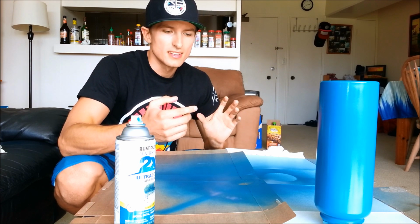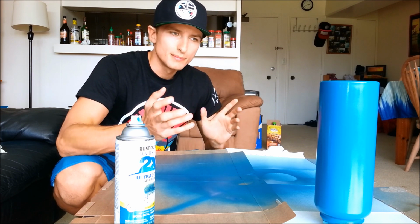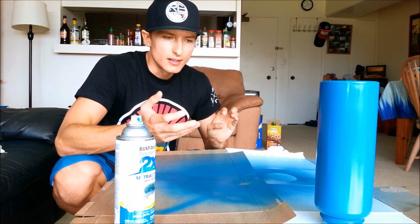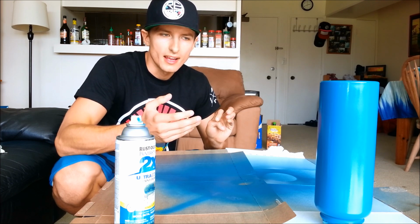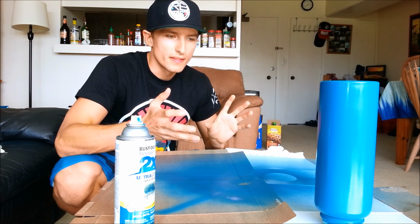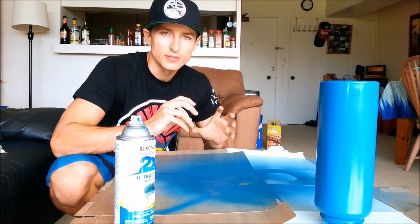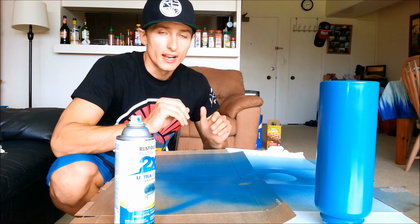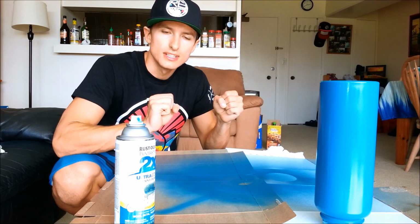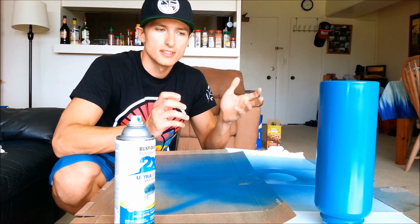Or another option is that you can put it in your oven or a toaster oven, and then just put it on maybe 150 to 200 degrees. Probably not even 200, because you don't want anything to happen to the tape or anything. So set it to like 175, and then put it in there and let the paint harden and really set in. That's the best way to do it. If we were doing it at an actual shop, they have a baking oven for the cars where it gets really hot, and this lets the paint dry faster so that it sets up better. So that's the best option.